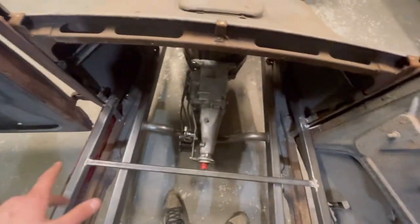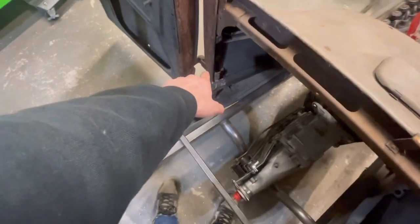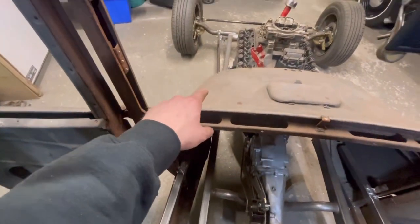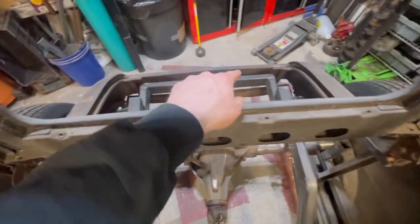So now we're gonna get this thing kind of squared up, measure a whole bunch, take a look at it from the front, measure, go probably from quarter panels, door spots, you know what I mean? From side to side, get the distances the same. Same thing as far as the front of the cowls to the end of the frame rails and such that way. The back's a little tough because the body's kind of bowed there.